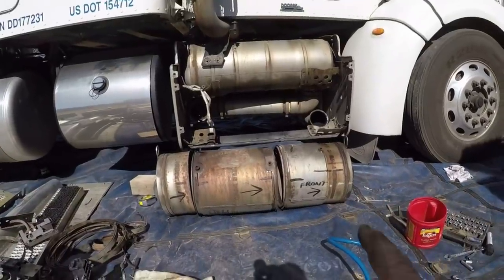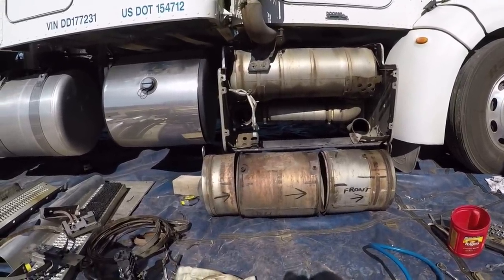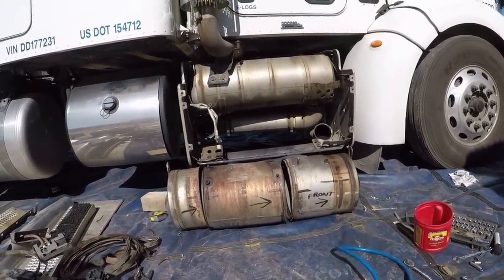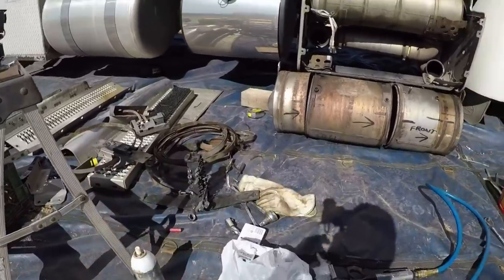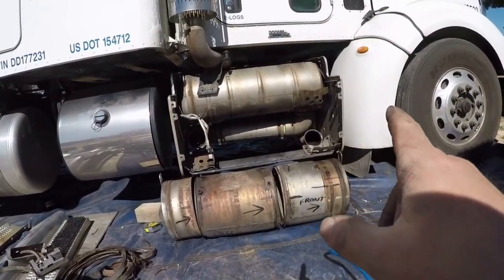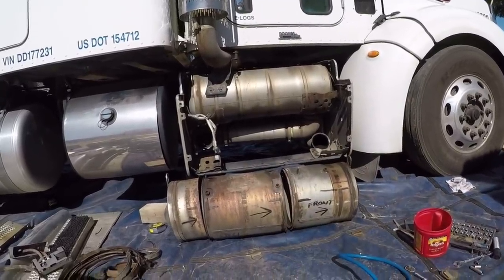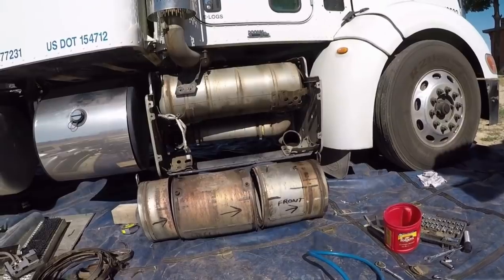This is what it'll look like with the three filters — I marked the filters to keep them in line, which will make it a little easier when I put them back together. We have new seals that go around in the new holes, they're just flat seals. We've got our big clamps right there. Once we get it all clamped together, we'll get it up in the hole and it'll sit in that little cradle. Then we'll get it lined up, put the new sensors in — you can see the holes where the sensors go — and I've got some high-temp anti-seize for those holes, good up to 2,000 degrees.